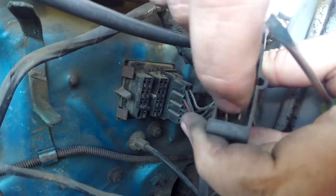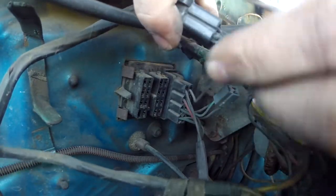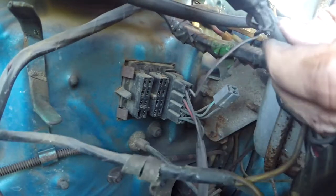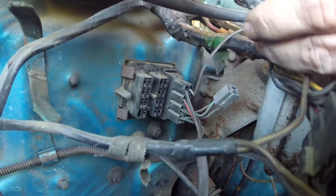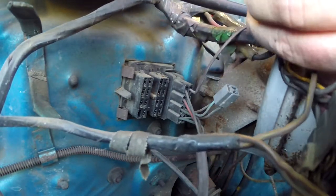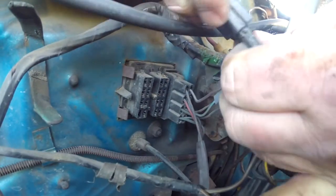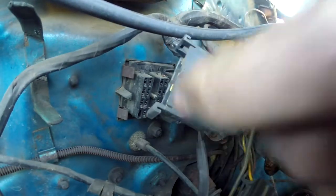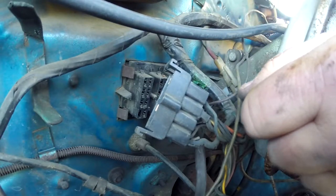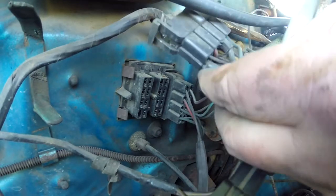You can see the way this one has fallen back a little bit. Look at that — I'm going to replace this. That's one of the main hot wires and it's actually feeling pretty bad. That's the one with the fusible link. That's garbage right there, that's part of what we're fixing. It's too flexible — I think it's broken inside. Without that wire you've got nothing. It's not burnt right out, but by the flimsiness I can tell that not all the wires are intact in there.